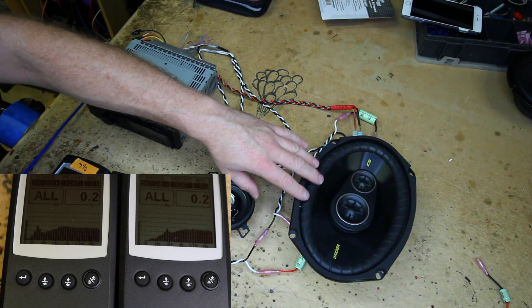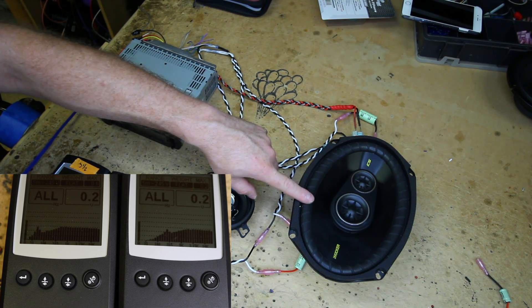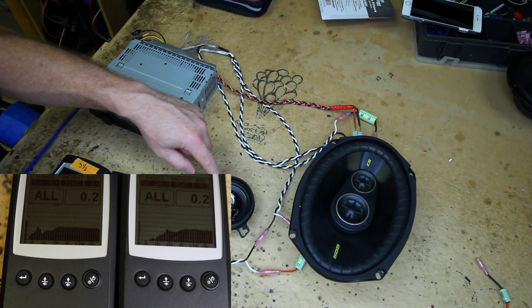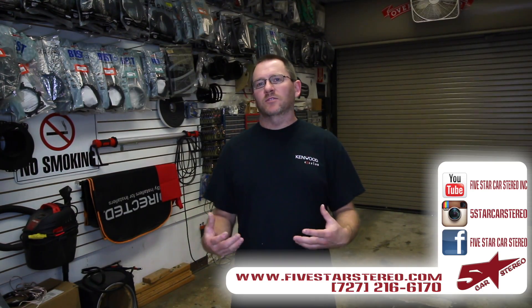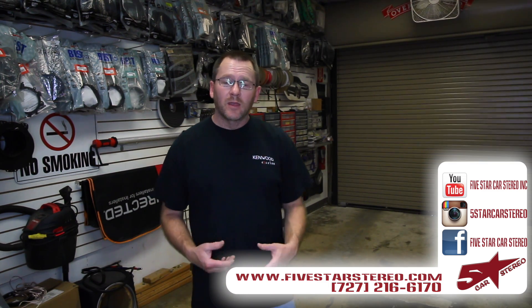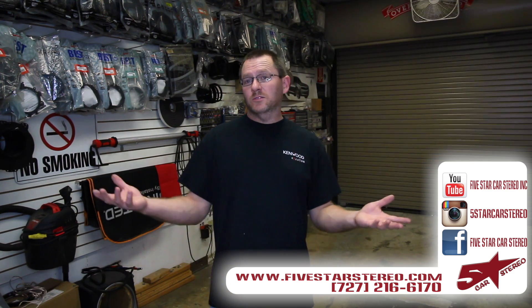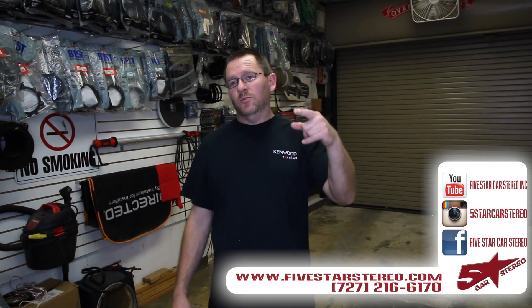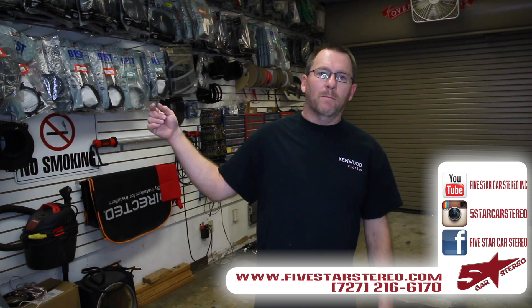So now you can see that the 6x9 is actively high-pass crossed over, so it's not going to play into your subwoofer. The 3.5 is actively crossed over, so it's not competing against the 6x9 to play deeper frequencies that it can't play. Alright guys, we hope you understand what bass blockers are and the benefits of what they can do for you — a little bit better now than you did before. If you have any questions about this video, please feel free to leave them in the comments. Please subscribe — hey, why not? If you want to know more about us, you can find us on Facebook, Instagram, and right here on YouTube. You guys have a great night, and we will see you next time. Bye.